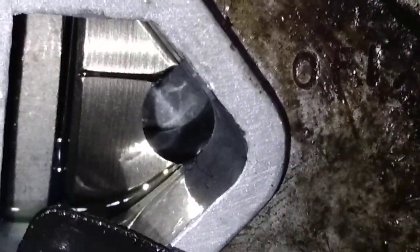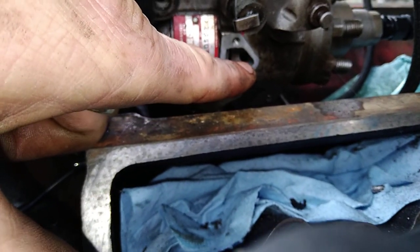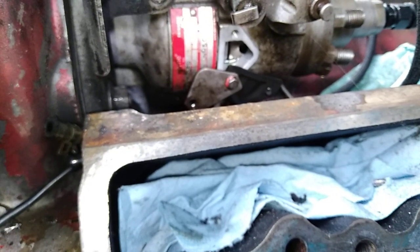Right there's the hole where you're gonna put your Allen — I think it's a five-sixteenths, I'm gonna have to recheck. The easy way to do it is to connect a socket to the bolt down there on the crankshaft, and then you can just stand right up here with your hand on the socket wrench while you peer through the hole, and turn the engine over until the Allen shows up in the keyway hole. Then you turn it clockwise to increase the fuel. It's already been turned up a half turn, and I'm probably just gonna go full send. That's how you turn up your pump right there.